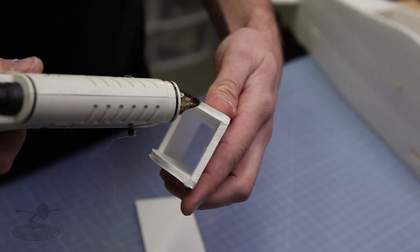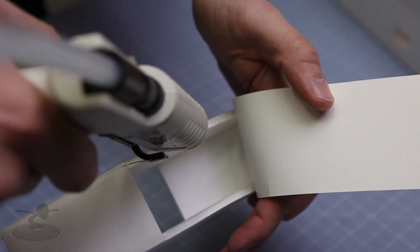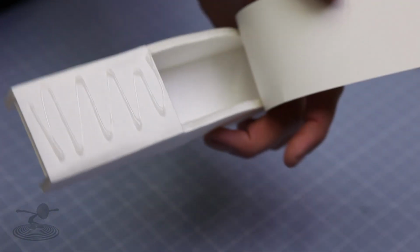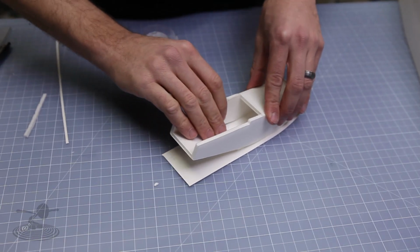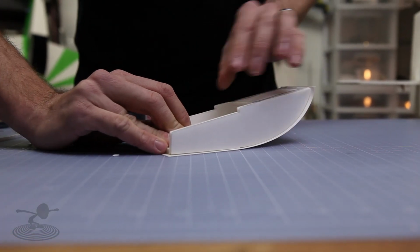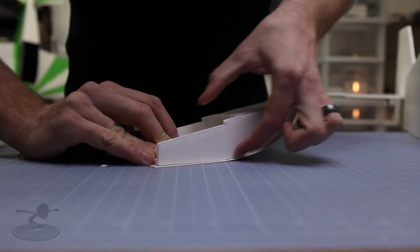First, going to put a bead of glue on the very bottom here, and then up roughly about 1/3 of the way. Now we're going to continue this on all the way to the back. Nice healthy dispersion on the top. Lay it back over again, and with the same rocking motion, keep those lines centered. Don't twist at this point. And then push forward against that tape just to make sure everything is getting forced back against the canopy.